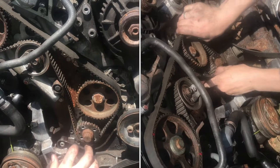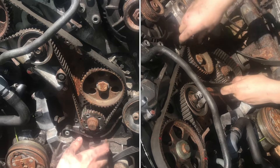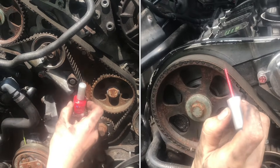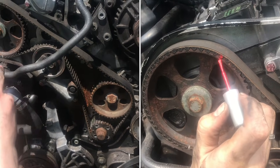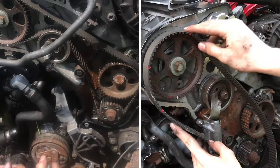If you're removing your timing belt, or you're changing it and it hasn't broken yet and it's still in good shape, or you need to replace it, you can use some fingernail polish or paint to mark where your timing belt is right now, so you can take it off and either transfer the marks or install the same one.